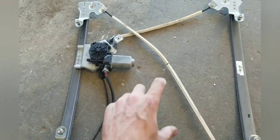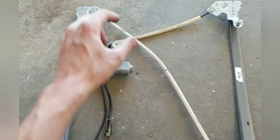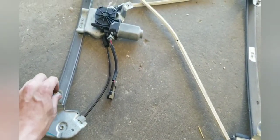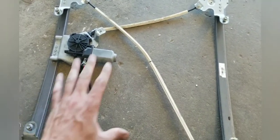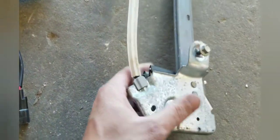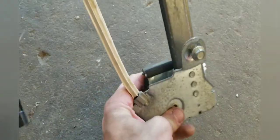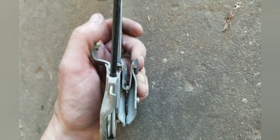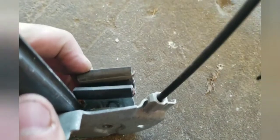There's going to be some slots, kind of slot-like, right in this area and maybe a little bit up here. But you're going to have metal around here because here's a mounting bolt that mounts the motor part of it, and then obviously you've got your other mounts. Here are your clamps — your window rests down inside of those clamps, and that bolt right there is what you tighten to tighten the clamps down. There's one on both sides. It's hard to see the bolt, but that's the point — you really just cannot get to that bolt.